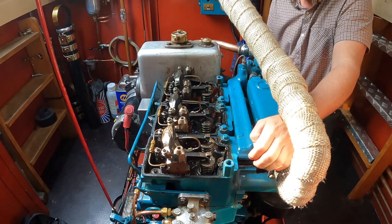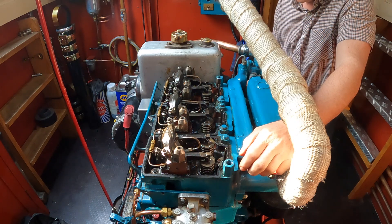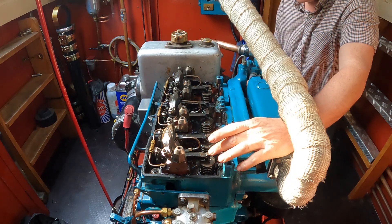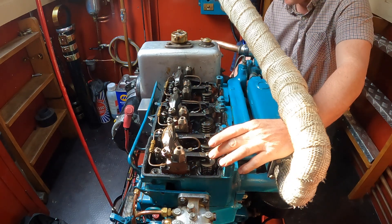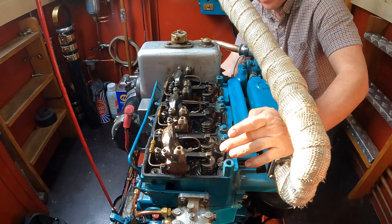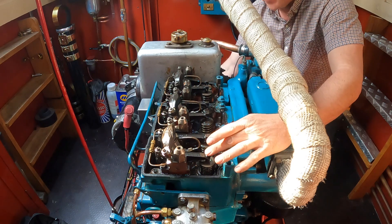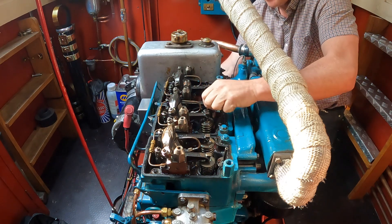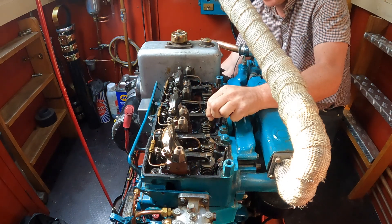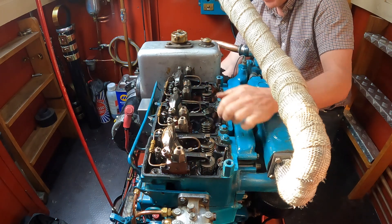Okay, as you can see, we've got the rocker covers off. We haven't got any timing marks on the front of this one. So what we've got to do is work out which cylinders — which valves are open. Which cylinder we know both valves are definitely closed, and therefore on the rock. So just by turning over here on the crank on the front, you can see on number one cylinder and number three cylinder we've got valves open. Therefore the middle cylinder, number two cylinder, they're definitely closed. And you can feel that because you can feel the play in them. I can already tell you that one there wants adjusting a little bit — it feels a little bit bigger than it should do.